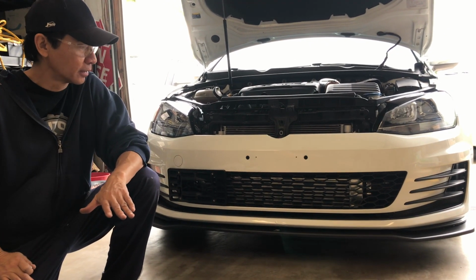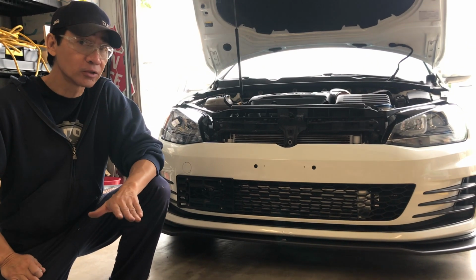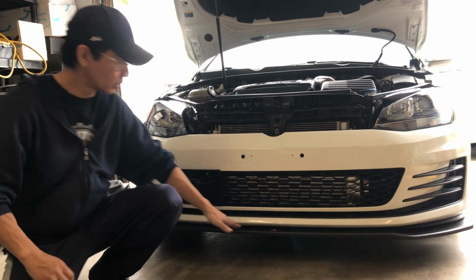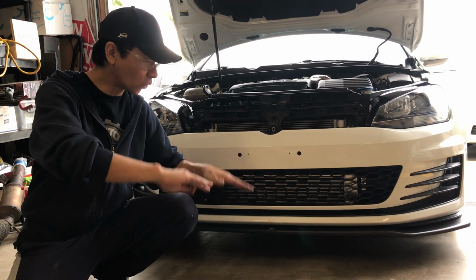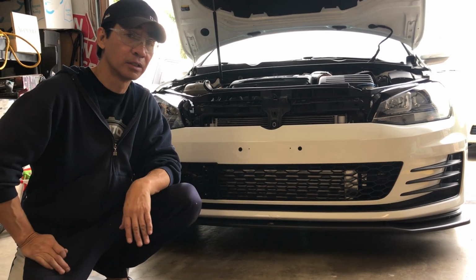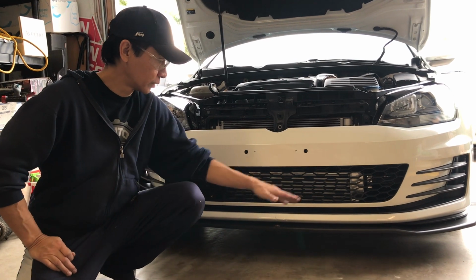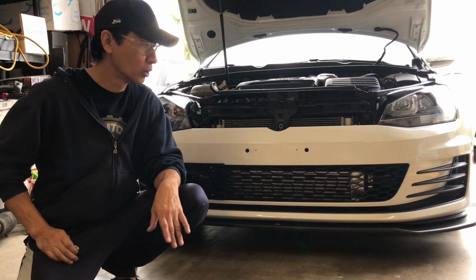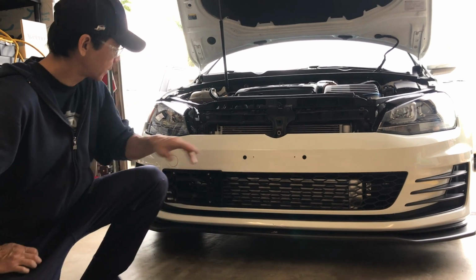So like I said, at least most of the screws have to be at an angle so that when there's downforce from the air, it's not going to make the splitter fall, because there's going to be quite a bit of downforce. So it's good to make sure it's stable and solid. So that's why I'm gonna get four more long ones on each side.